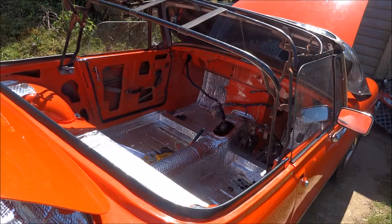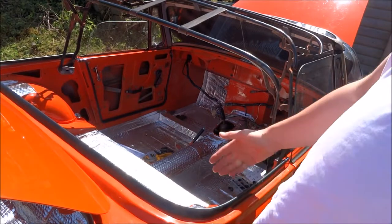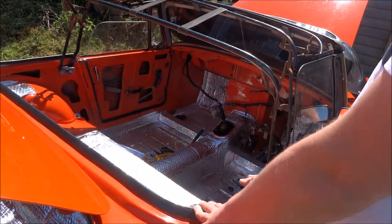What I tend to do with the filters is use them until they start getting dirt in them and they're blocked up and you can see paint particles on the outside of the filters, then you can start to throw them away. If you're just doing a little job, you could probably get away with it, but you don't have to keep buying new filters for everything, because they are quite expensive. But like I say, health and safety comes first, so make sure you do that first.